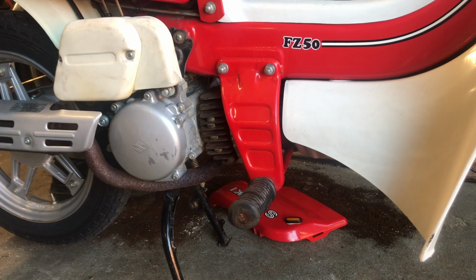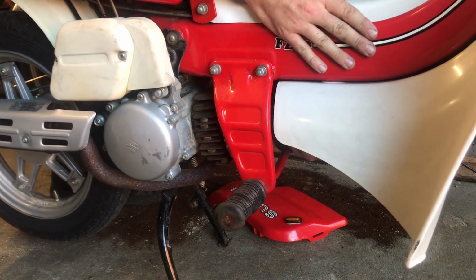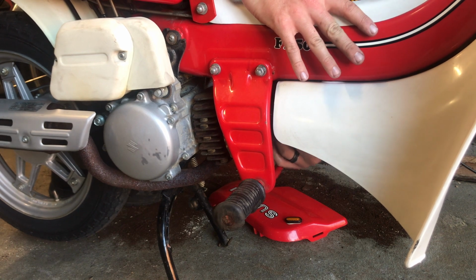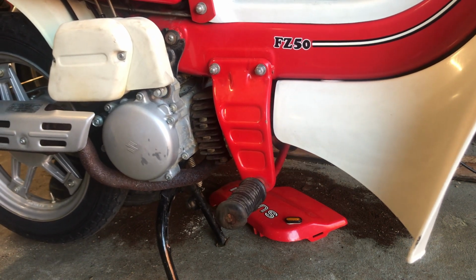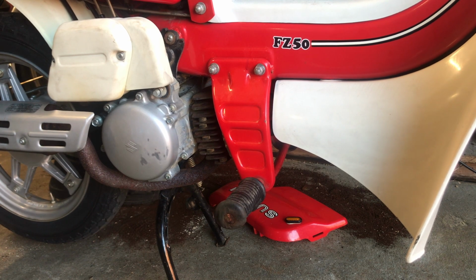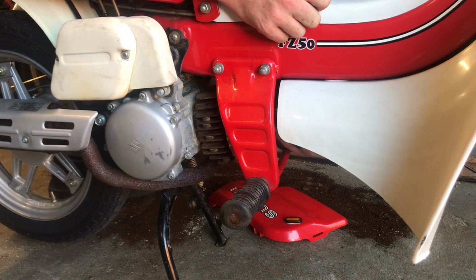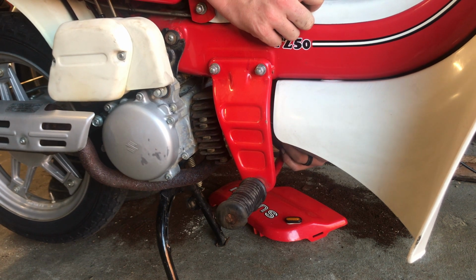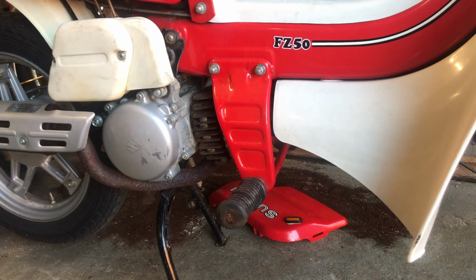My lazy self didn't want to take the shield off, so this isn't going to be the best video to show you what I'm doing here. But basically I have a screwdriver on the piston, and I'm slowly cranking over the bike to make sure the piston is covering that exhaust port so no moisture or air gets into the engine. I do plan on making a better video that's more visible, so subscribe, stay tuned, and you'll see exactly what I'm talking about.